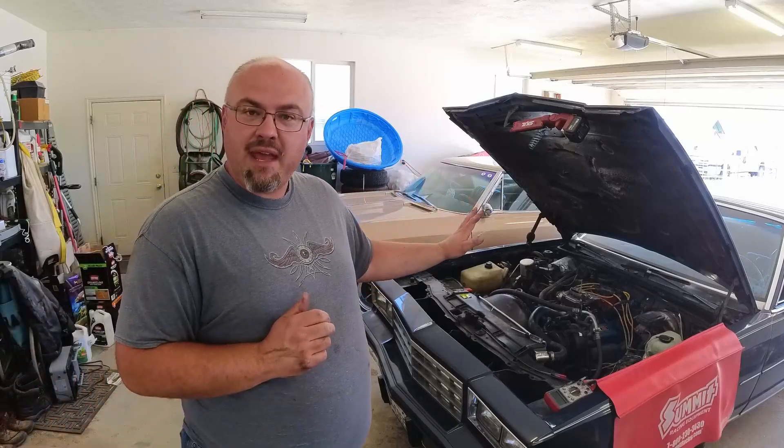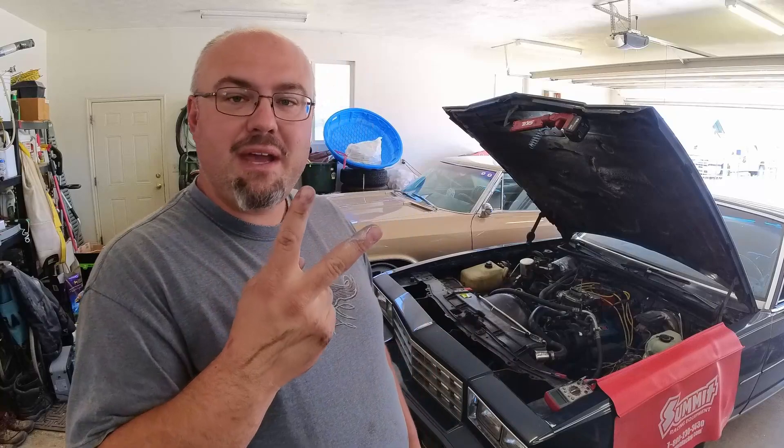I understand that if you're a seasoned veteran you know this already, but there are a lot of people who are just getting into cars for the first time, and a crank-no-start like that can really trip you up if you've never experienced it and don't know what you're looking for. The GM HEI ignition module is a very common failure. Unfortunately, from what I'm hearing from my mechanic friends, electrical components are not getting any better — they're actually getting worse. I replaced this module a year ago, almost to the day, and it's dead. Get quality parts if you can. Sometimes you might want to pick up two so you've got one on hand, because realistically this is a 20–25 minute fix tops, but it can totally wreck your day because the car doesn't go anywhere.